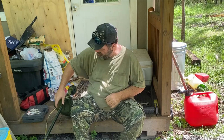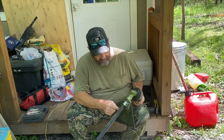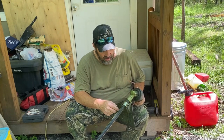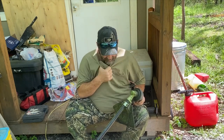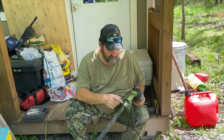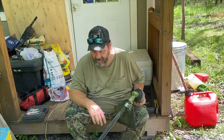Here it's all cooled off. This bolt did vibrate loose and my guard fell off. So I went and got some red Loctite and put it on there. I don't ever suspect I'll need it off, and if I do, worst case scenario, I'll just cut it off, right?